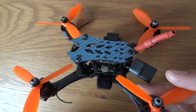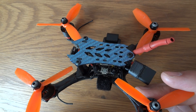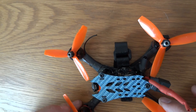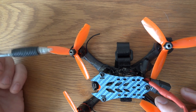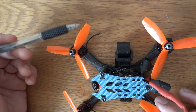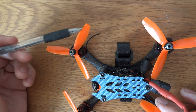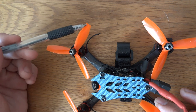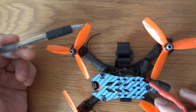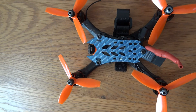I added in the soft mounting and when I test-flew it again, it completely got rid of my hot motors — they came down absolutely cold, which was fine. As you can see it's had a little bit of a bashing. The props I'm running are Rotor X props and they're really good, but if you sneeze on them they basically splinter and crack. I didn't even crash, but landing in soft grass I've taken chunks off them, which caused a bit of vibration towards the end of the flight footage.